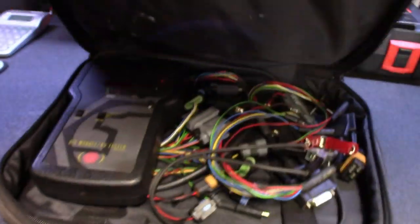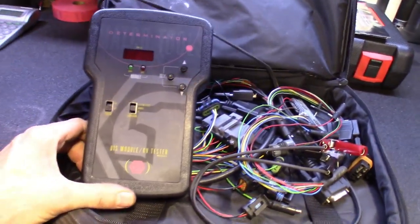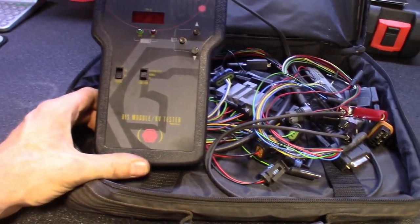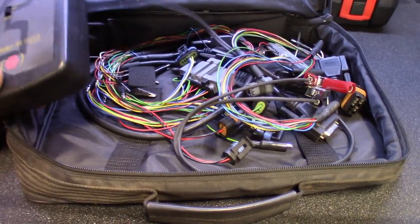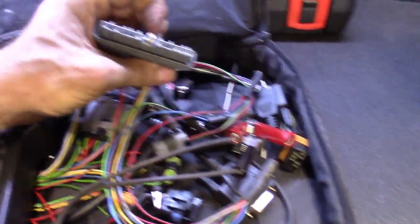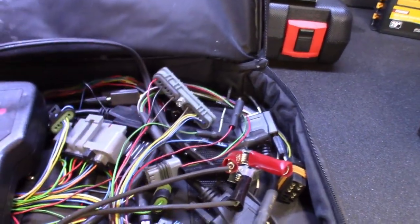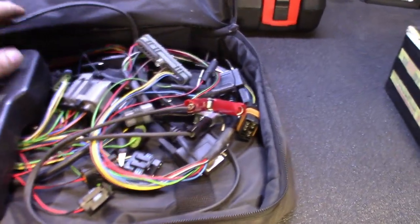Taking it back old school — I still got the Mako DIS checker that I used to use the heck out of. I use it a lot less now because that technology really isn't getting used as much anymore, but I used to check these for bad ignition modules and drivers. This was great for checking the DIS modules on the Thunderbirds, the Supercoupes, and the Fords. It's got all the connectors — here's the GM connector for checking the ignition module — you plug it in, run the test, tap it a little bit, and it would tell you if it was good or not.